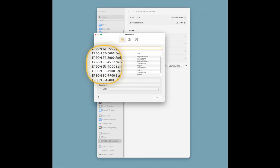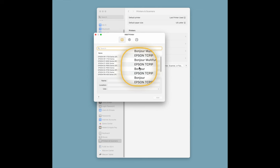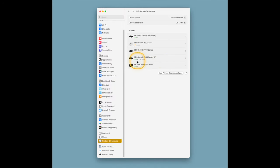Go to 'Add Printers' and a box pops up giving you a list of printers it sees connected. You can see we have a P900 here, and it gives us two choices: Bonjour or TCP/IP. This part is very important — do not, I repeat, do not select Bonjour. Bonjour will not work with wireless printing through the Epson system. This is the thing they don't tell you very well in the manual. So we go back and select the Epson P900 Series TCP/IP.